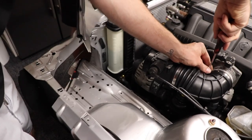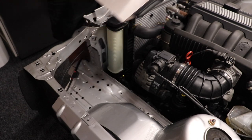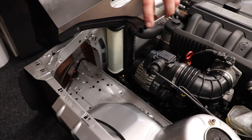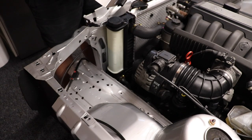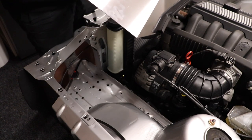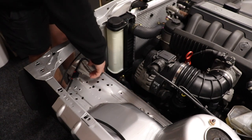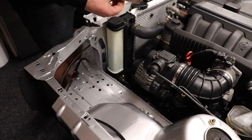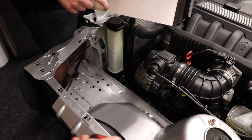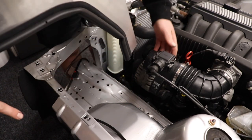We've just put the rubber strip on just the edge that's going to be going over the wheel well. We've lined it up with the edges as best we can so it sits as flush as possible. This part of the actual box we've cut and bent so it sits flush with the bottom of the rail. That way we can mount our brackets that Luke is currently bending at a 90-degree angle, and we'll just use one of these mounting holes — probably that one and that one — but we'll figure it out.